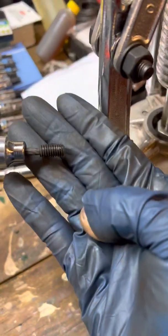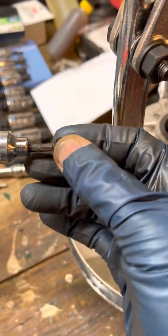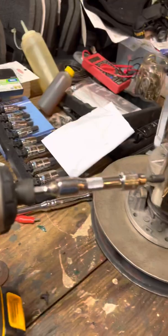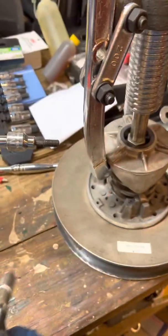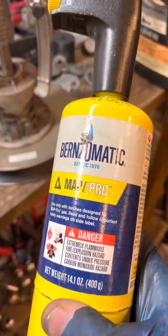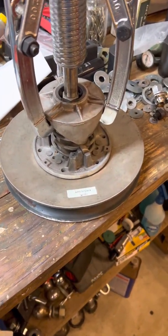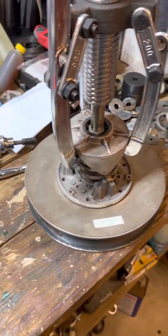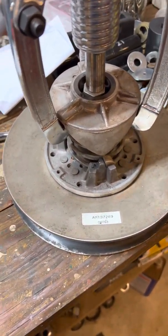That's the screw right there. It's pretty long, as you can tell, and they've got it in there with some serious Loctite. The way you're going to get that out is heat. I started with my wife's creme brulee device, thinking a little bit of heat would do it — that did not work. Then I tried map gas, and at first that didn't work either, but the actual instructions say you need five minutes of heat at 450 degrees on the Loctite. So I put it on for five minutes with map gas, and it was smoking, you heard some cracking, but eventually out it came.